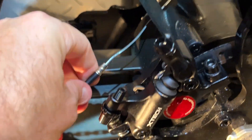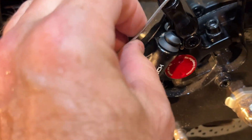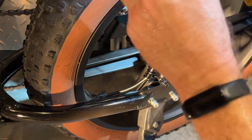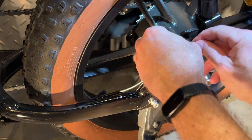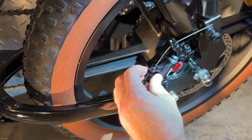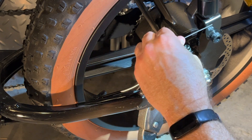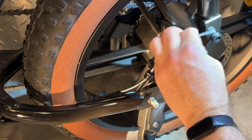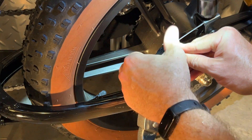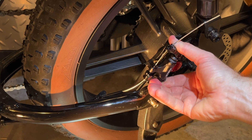Check to see if the brake calipers are engaged — they are. Make sure the rotor is not hitting the caliper on the bottom or top — the spacing looks good. Now I'm going to feed the cable through and get that situated. I'm going to feed the brake line through here, loosen this bolt, and feed it under like this. There's a little adjustment here so I can move it up or down to provide different tension as needed. I'll pull this down a bit so it's somewhat tight on the rotor.